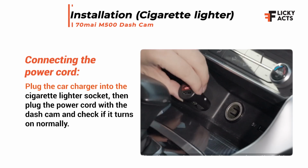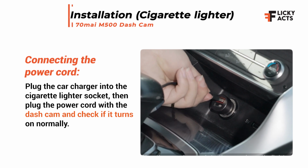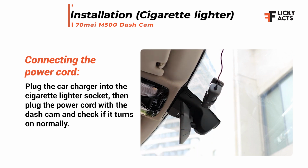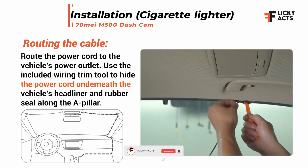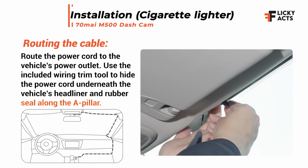Plug the car charger into the cigarette lighter socket, then plug the power cord into the dash cam and check if it turns on normally. Route the power cord to the vehicle's power outlet. Use the included wiring trim tool to hide the power cord underneath the vehicle's headliner and rubber seal along the A-pillar.